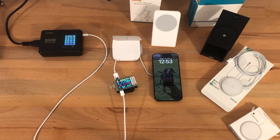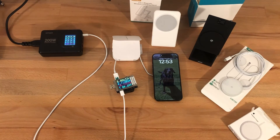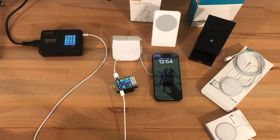That's not necessarily a bad thing — 7.5 watts is decent for a wireless charger, and if you need the convenience of one on your desk or the economy of buying two for the price of one Apple charger, it may still be a good option. But if you're looking for the absolute maximum wireless charging, it looks like you really need to use the Apple branded MagSafe charger, run off an AC adapter or DC-DC adapter that can provide power delivery at 9 volts and up to 2.2 amps or higher. The best way to get that is to look for a 20-watt charger or higher.